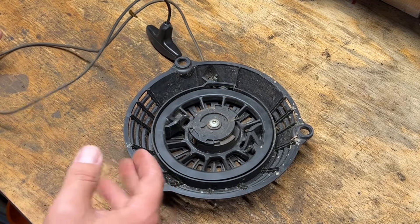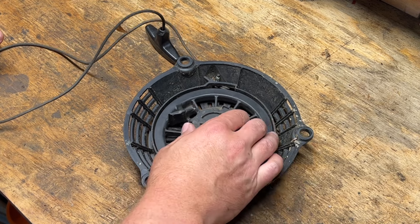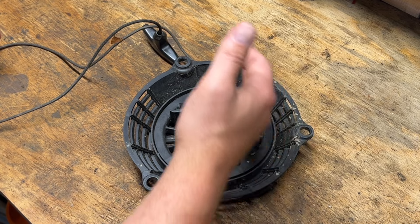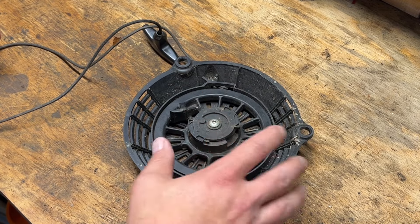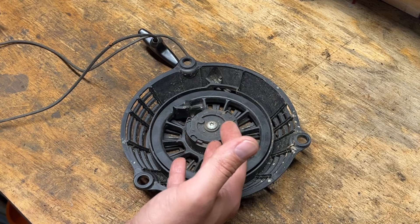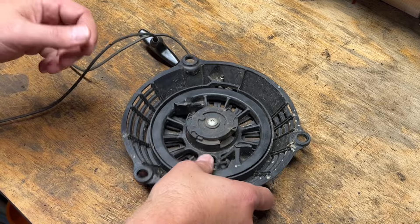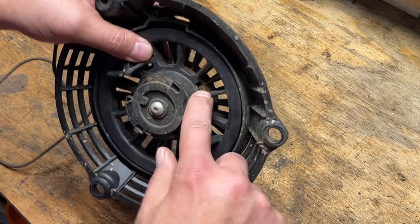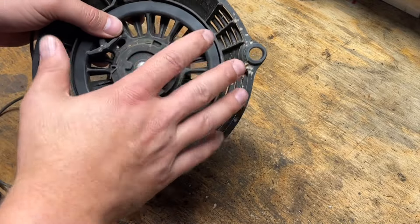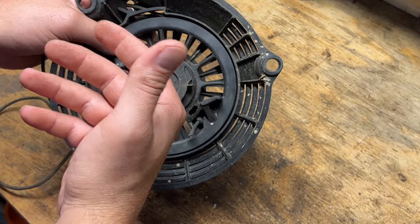As I was walking in here, you can kind of see it's creeping along trying to retract itself in, which is good — it means we don't have a broken coil spring to deal with. If the spring is broken, you can probably get a whole recoil replacement for the price of just the spring, so that's probably the easier route. But I noticed the end of this one is really rusted, so we probably have a dirt, rust, or lubrication issue where there's just too much friction for this to retract correctly.